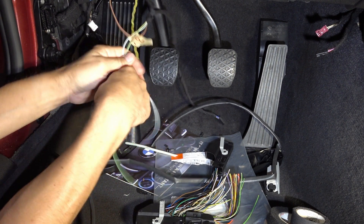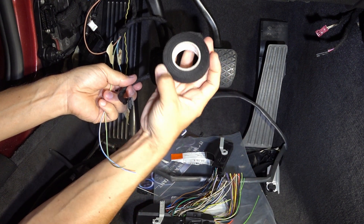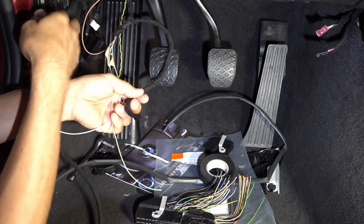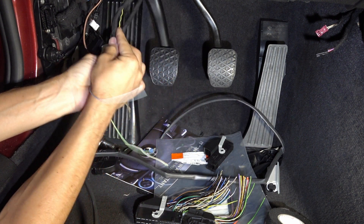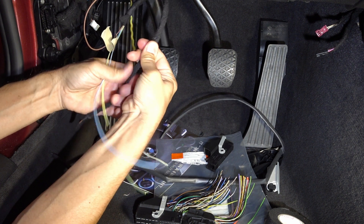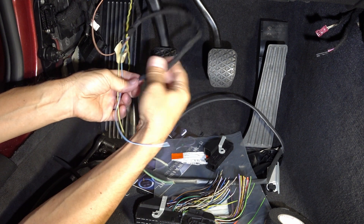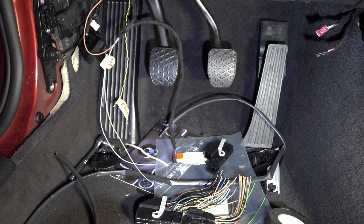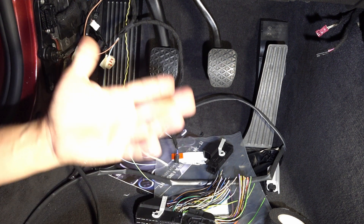That wire has to be replaced with this wire that I added, as part of a custom harness. I also bought this cloth tape that is exactly the same brand as what BMW uses for their wire harnesses — it says made in Germany and looks just like the factory tape. I'm running that tape over all my new wires so once everything is plugged in, you won't be able to tell the difference between factory and non-factory wires.